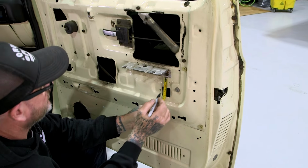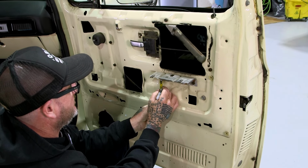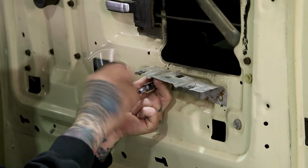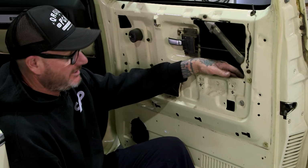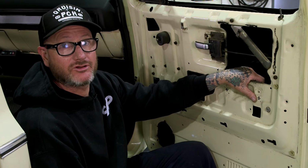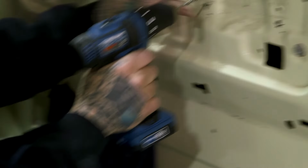There you go. So I'm dropping that 3/4 of an inch. I'm gonna go ahead and mark that now, and we'll drill the holes. We're just gonna use sheet metal screws because they actually have little nut certs in there. And I'll mark it. There's one. Make sure it's straight. I'm gonna go ahead and drill these holes out. Be sure your drill bit's not too long and you end up going through your glass also. Kidding.